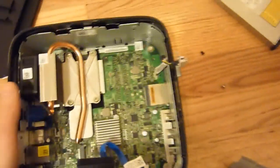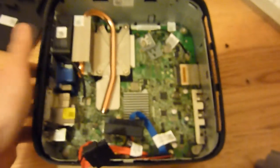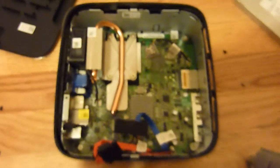If you want to remove the memory, simply turn it upside down. There are two feet on the bottom — one there and one there — that have screws. Undo those screws, pop off the bottom lid, and you have access to both memory sticks.